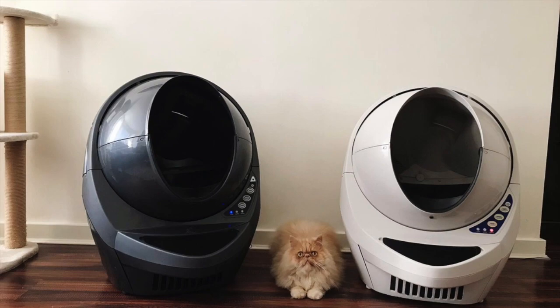This happened after I'd cleaned the Litter Robot — I'd taken the dome off and did my best to replace it in the exact position I took it off, but it mustn't have been bang on. That meant when it finished cycling it wasn't in a perfectly aligned position. To cure this, I had a look on the Litter Robot site for troubleshooting, then I simply unplugged it at the mains and plugged it back in, and it cycled back into the correct home position — that cured that problem.